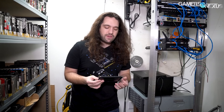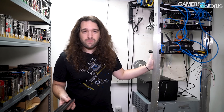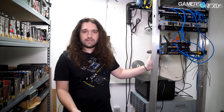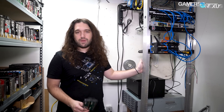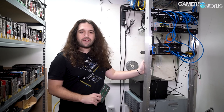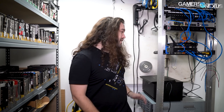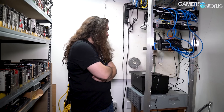You should watch the video with Wendell if you haven't seen it. The memory running low hasn't caused any noticeable performance problems, but I'd like to start running a VM on there to actively compress things. This server box has a Navi GPU in it, and it'll work great for x265 compression. To do that I'm going to need more memory for the VM to be constantly running — that's what this upgrade is for. The downside is I can't swap it right now because everyone is using the server, so I just wait until everyone goes home.